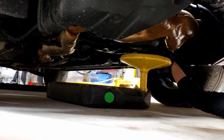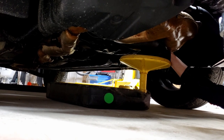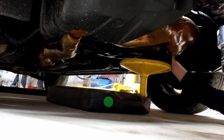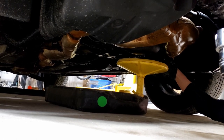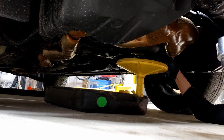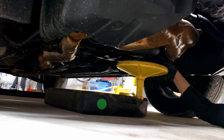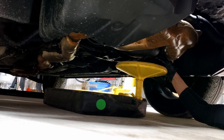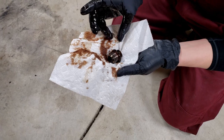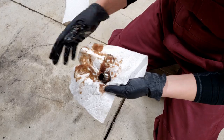Be careful when you are getting the bolt out for a couple of different reasons. First, I don't want to lose it in the bin — like I just did. And second, you want to make sure that the crush washer or whatever washer you have on your vehicle comes off with the bolt. In the Subarus, that washer must be replaced every time. This crush washer is going to get tossed, and I'm just going to wipe this off to make it easier to put back on.